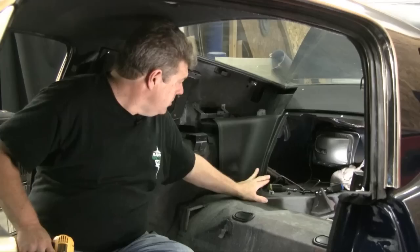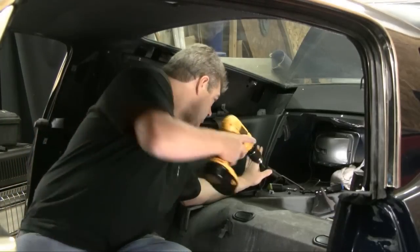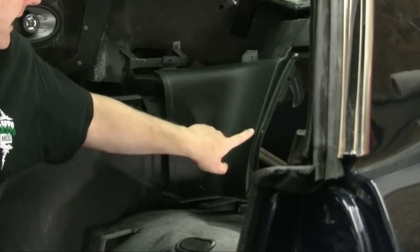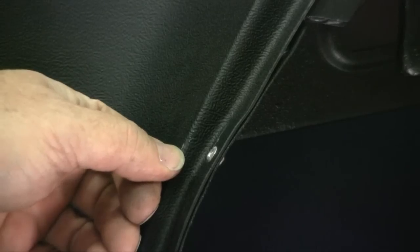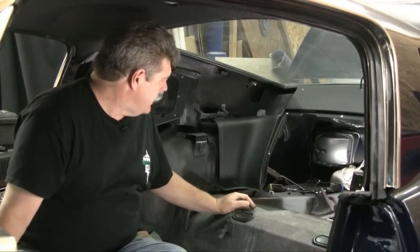Since this hole was not conveniently drilled by the factory, we're going to drill it out so we can get the pop rivet in. We're going in with a smaller bit first, then come back with the correct size. You don't want to put a lot of pressure when drilling like that because you can end up colliding with your panel and creating a little nick. What I'll probably do is dress that with a little bit of black paint — we can also use trim black with a small paintbrush to fix these little nicks and make that look better.